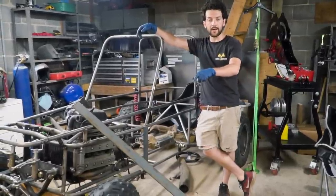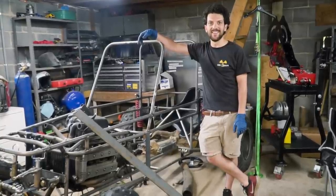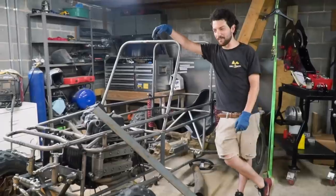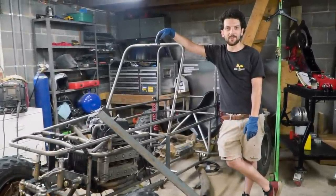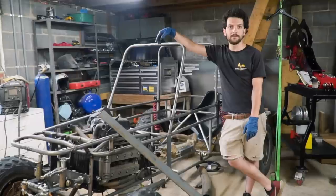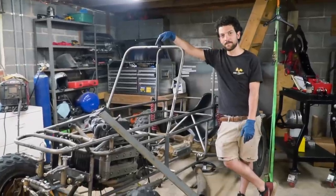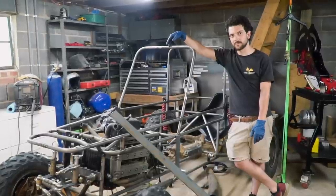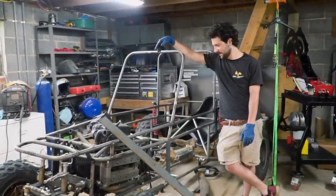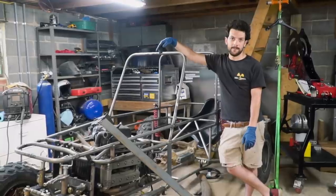Our other option is a manual steering rack, which is six and a half turns lock to lock, and I just think that's too much. I don't think we want sailboat steering — like pirate ship steering — on this thing. I'd rather give up the extra 15 pounds and have something that steers properly. Of course we could go out and get a new steering box, but they're $400–$500 or more — stupid expensive. Somewhere there's some sort of ATV or off-road vehicle that has a little tiny aluminum steering box that would work perfect for us, and I cannot find one. If y'all know where one's at, let us know in the comments. We're going to make this thing where we can take it off and replace it with something lighter.